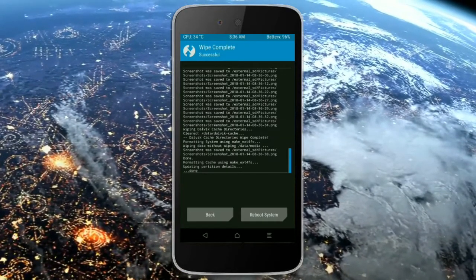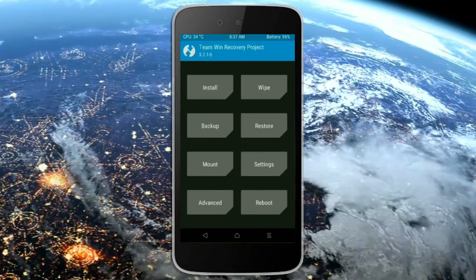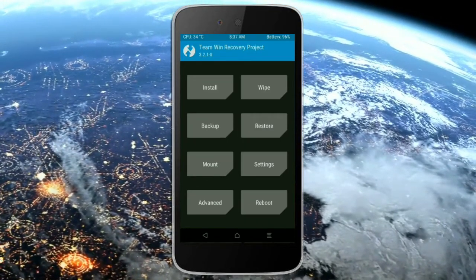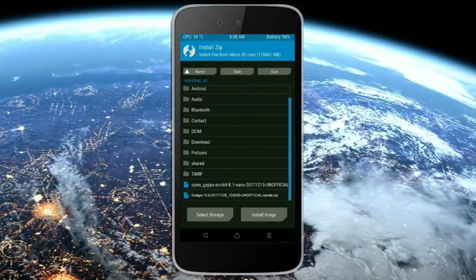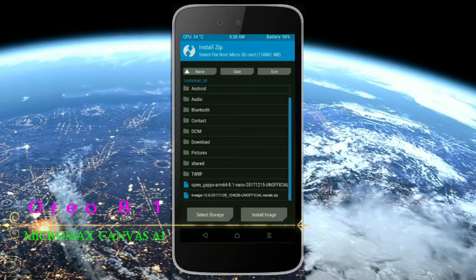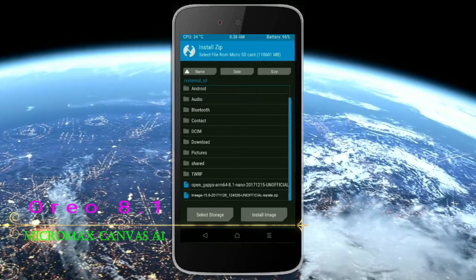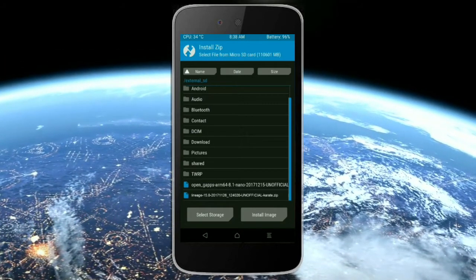We need to go here to install the ROM. Press back. Here you will find install. Select Oreo 8.1. Friends, I have provided the latest version custom ROM and GApps which are suitable for your device — please find the download link in the description below. After selecting the Oreo 8.1 ROM, swipe right to install.